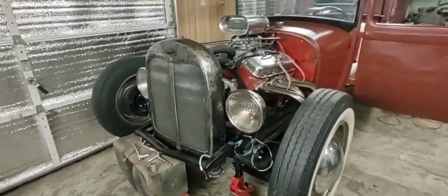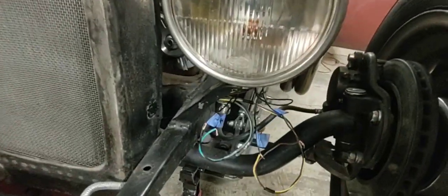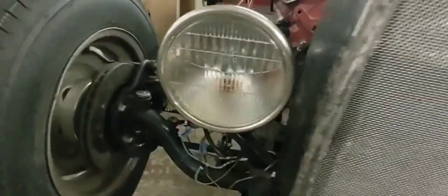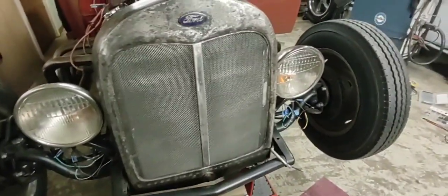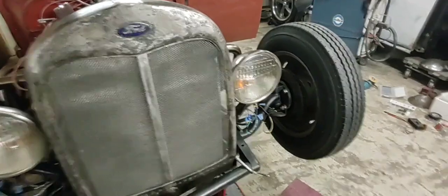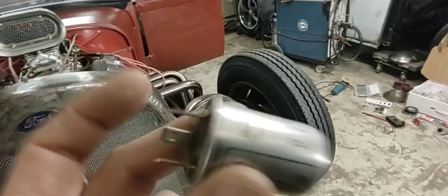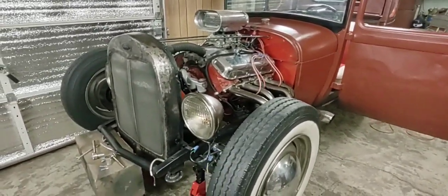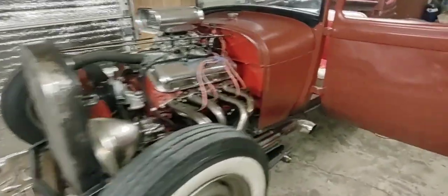Alright, well, I got the headlights bolted back on there. Just got them all wires twisted together. I got the passenger side headlight done. Got it bolted on there. Got the wiring there. So I hooked this all up and had all the lights working, but my blinkers wouldn't work. Had a bad flasher if you hear this. Yeah, she's toast inside, so I had to go buy a flasher. I couldn't figure out what was wrong with it. I would hit the blinker and the tail light would go off, but no blinker would come on. But it all works now.